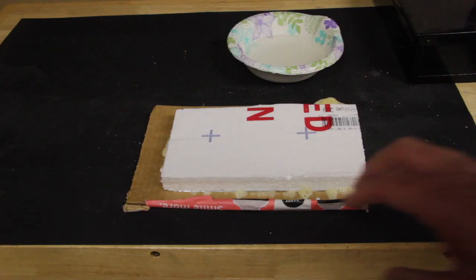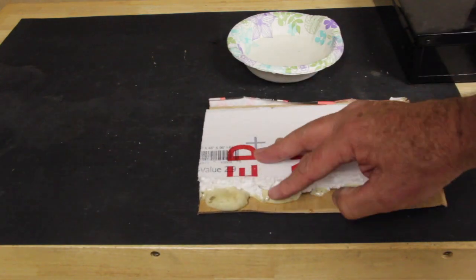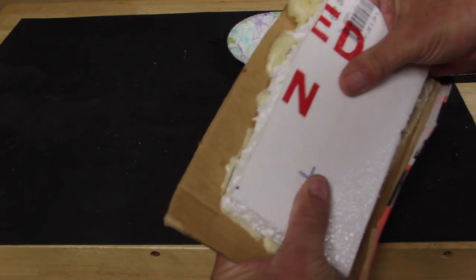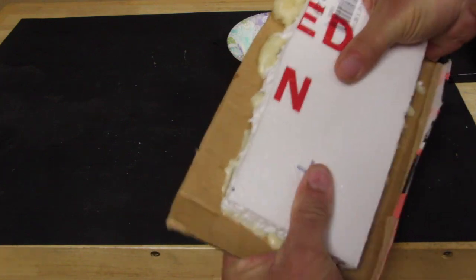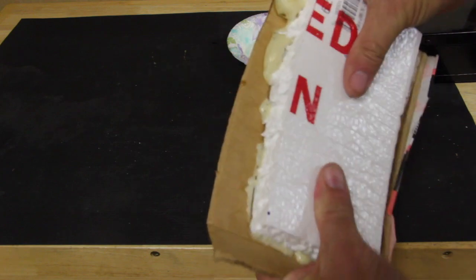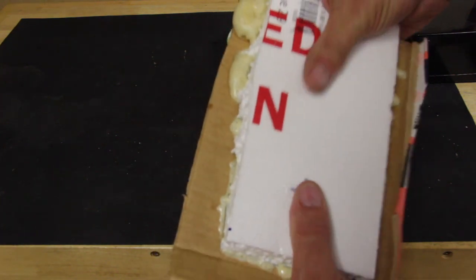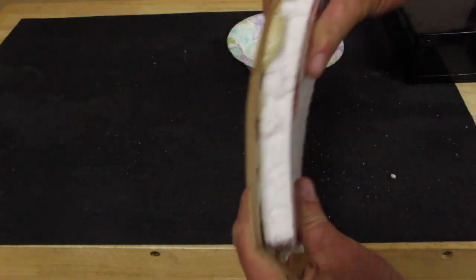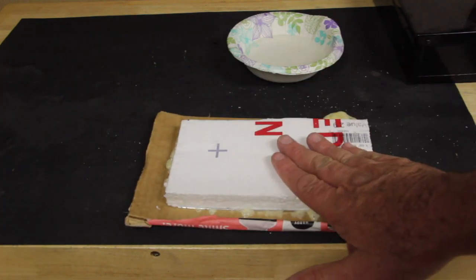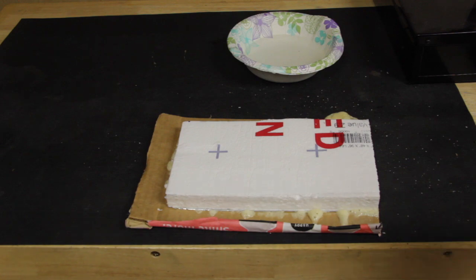It's now been 24 hours. The bulges of the polyurethane glue are really hard. The reason I wanted to wait a full 24 hours is to make sure it's still somewhat flexible. I really like that — the glue is not pulling away from the cardboard at all, and the foam is still flexible. The canvas top on the camper is not going to flex that much, but it will flex a little bit. I'm quite impressed with that, so I'm going to go ahead and use this technique when I install the insulation on my camper roof. Hope you enjoyed this video and we'll see you next time.